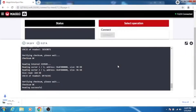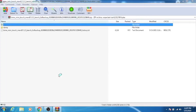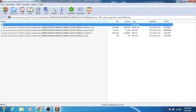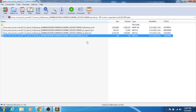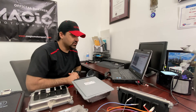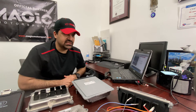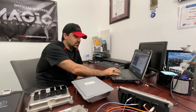So here we have a file ready — always save all to download that. Within that compressed file you would have a notepad that gives you all information about the different processors and EEPROMs you're connected to. And in the dump you have the full backup — that's a Magic Motorsport file. Either you can, if you have a tuner you work with or tune yourself, load the flash, tune the file, and write it back in. Or if your job is just to replace the ECU because it's misfiring the engine, you would rewrite the whole backup into a used ECU and you're good to go.